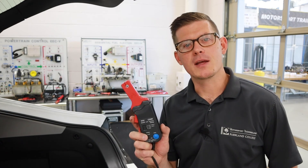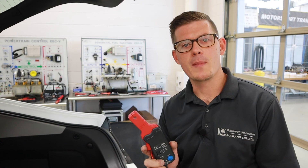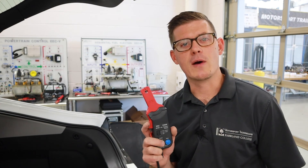In order to check for this, we need some kind of tool that's gonna measure current. One option is just a basic DVOM, but that requires that I disconnect one side of the battery — we'll talk about why maybe that's a poor choice. My other method is an amp clamp like this one. This one uses an inductive pickup that just goes around one of the battery cables and looks for the magnetic forces generated by current flow. This is a great tool because I don't have to disconnect anything and disrupt modules.